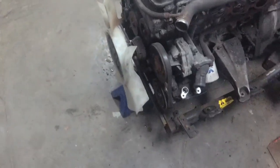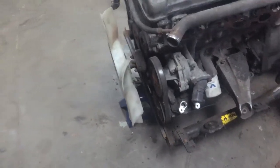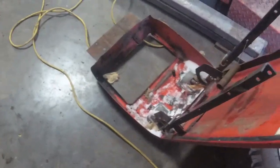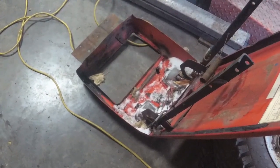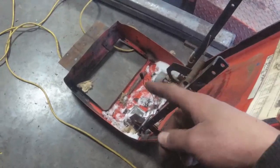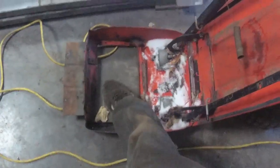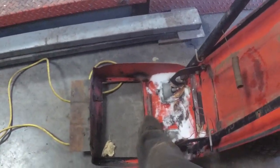Let's get rid of the stupid fan there. We're doing an electric fan — a Civic EG old-style Civic rad — because that will fit in the width there just fine. I might open that up but probably not. It'll fit in the width and I think we'll be fine with the cooling. Whatever — we're gonna use the AC condenser fan off the Tracker. It's really low profile.